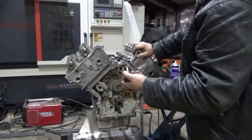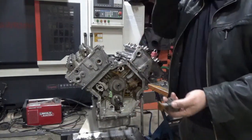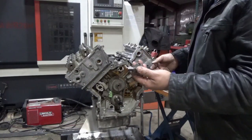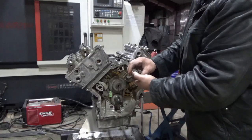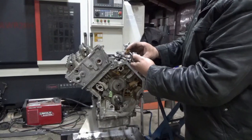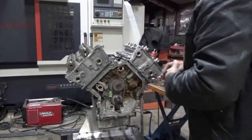What I suggest when building these engines: obviously use new timing sets — you can't go wrong with new timing components. But they're often not worn out, they're just stuck. Run some brake cleaner through it, retract it, and keep doing this. You'll find it'll squeeze out the old oil and get the tensioner functioning nicely again, so there's no need to replace them often.